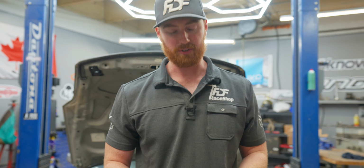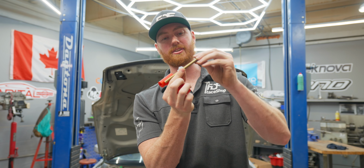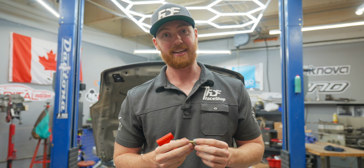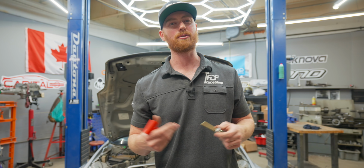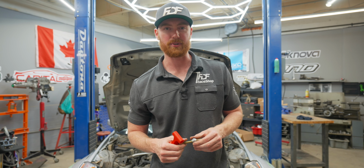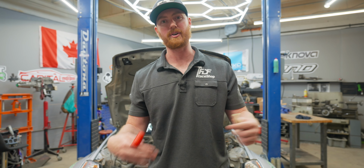and you'll actually see this bar pivot on an angle and apply pressure in this manner. There is a limit to how much you can bias mechanically, because if you biased it simply too much, the force applied would basically overexert this rod. You would just try pushing the master with this rod fully kicked like that, and you'd probably put dents and stuff in these, and it would wear out components faster. So you can't really mechanically bias more than, I think it's somewhere around 65 to 70% from front to rear mechanically.